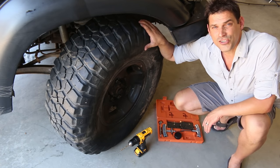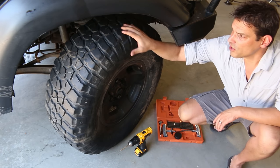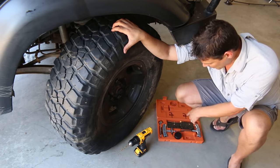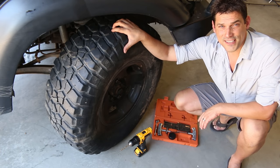Ideally if it's not a slow leak, you also want your trail repair kit somewhere you can reach it relatively quickly so it's there when you need it. When you find the hole, cover it with your finger to keep the air from coming out, then move quickly with your tire repair kit to repair the hole while there's still air in the tire.